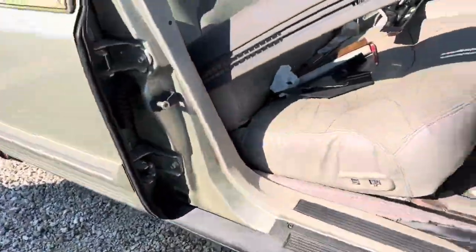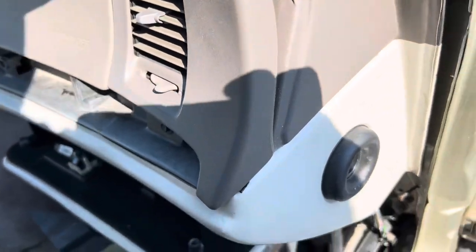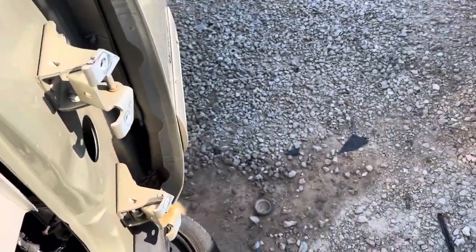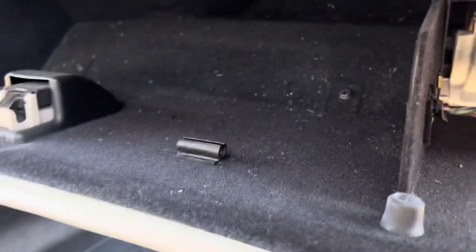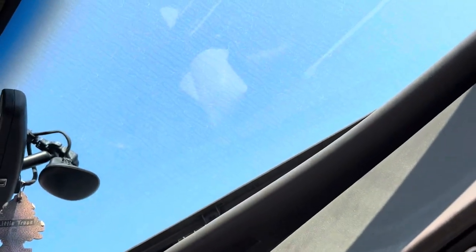Let's see if we got an airbag here. We do! Let's carefully move this out of the way. Someone's already pulled the radio for us, but our airbag is here and it's intact. So first thing we're going to do is drop the glove box — you remove the little piece and then carefully pull in and drop it.